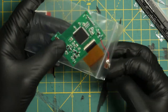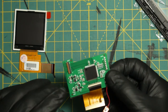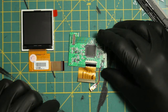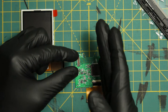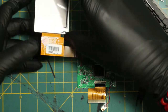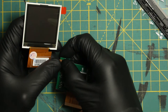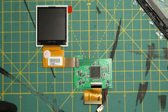From Handheld Legends' tutorial, they say lay the screen on the left side and then lay the board on the right side, holding it in a very specific way. This is the touch sensor right there — the dimmer — and I'll show you how that works at the end. You're looking at the ribbon cable on the screen and the brown strip at the very top. This strip flips up, and you just slide the ribbon cable in and close it down. This actually slides in — you'll see it here — nice and easy. Push the clip down and it's locked. That's pretty much the entire assembly. Push it in, it clips, and you'll feel it too. That's the assembly, hands down — nothing crazy. You're a modder now.